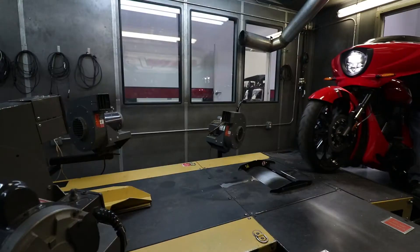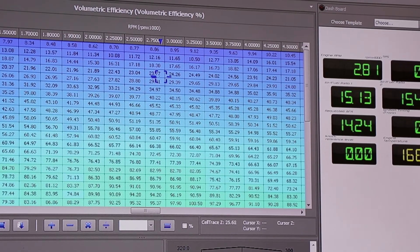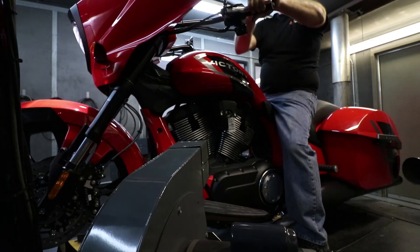It will make more power and torque. Pre-developed tune files are actually made by taking a bike and strapping it down on one of our rear wheel chassis dynamometers. We extract the exhaust gases while we're running the bike on the dyno and we analyze those exhaust gases with a wideband O2 sensor. And that tells us where our air fuel ratio is at, and then we can add and subtract fuel if necessary to get the air fuel ratio where we want it for most performance.